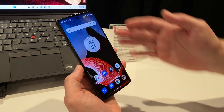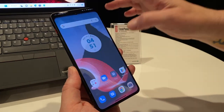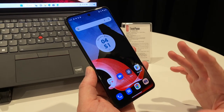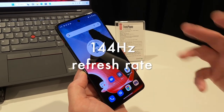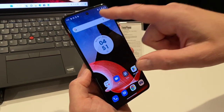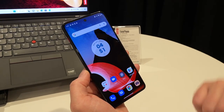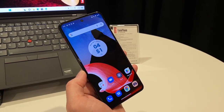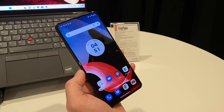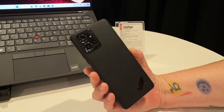The display is kind of the star of the show here. It has very little bezel — very uniform — and if you pull down you can see the bezels are pretty much the same all around. It is a 6.6-inch plastic OLED display with 1080p resolution. There's a hole-punch camera in the front: 32 megapixels with autofocus, f/2.4 aperture, 0.7-micron pixels, also doing 4-to-1 pixel binning for better quality in low light.